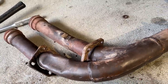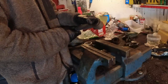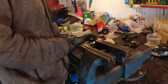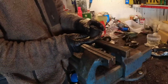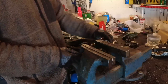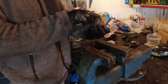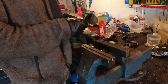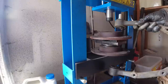Back at the bench. Here is the lower wishbone and here are the bushings we're going to replace. These actually look better on this side — but this is one of the ones on the other side, so yeah, definitely need to be replaced. You can do it with a vise — no problem at all. Just get a big socket and a smaller socket and push it out. However, I have the luxury of having a press, so I'm going to use it. Let's go over there, press these out, clean it out, and put in new ones. Pretty straightforward — we're going to get this in here and just make sure it's resting on the edge. Old brake discs from a Fiat 500 are really good for giving you lots of options and holes to push things through.